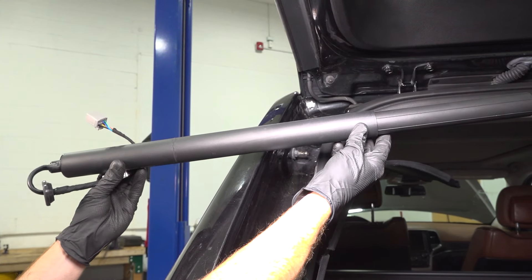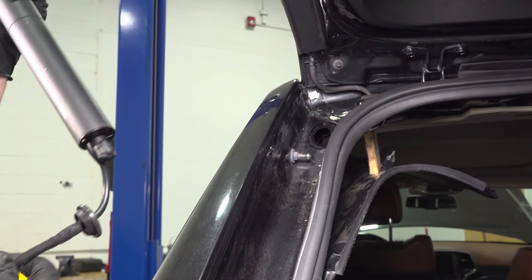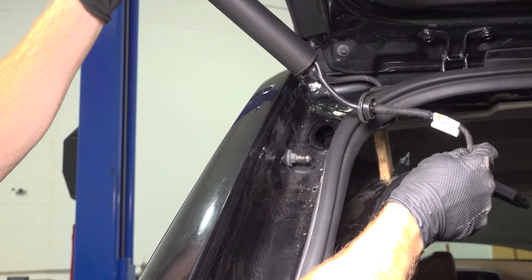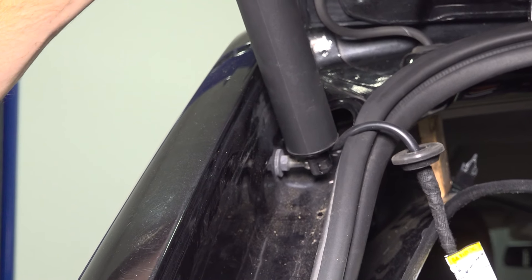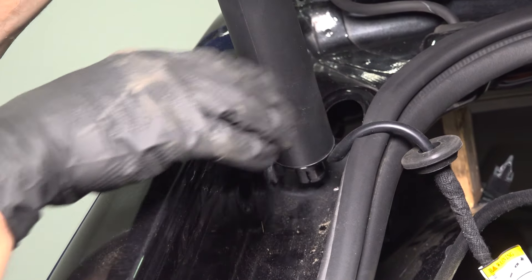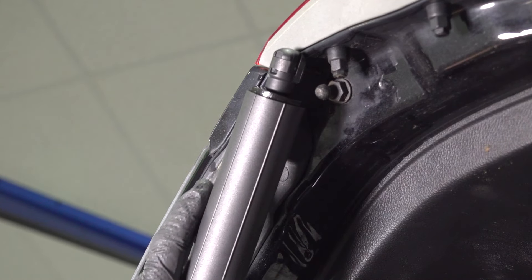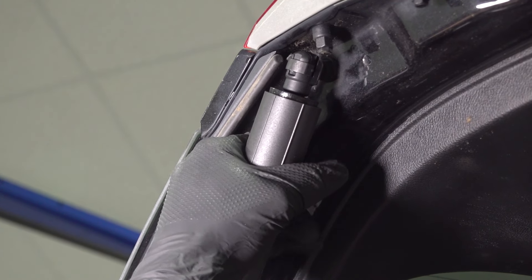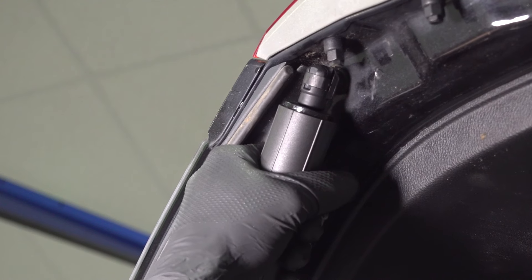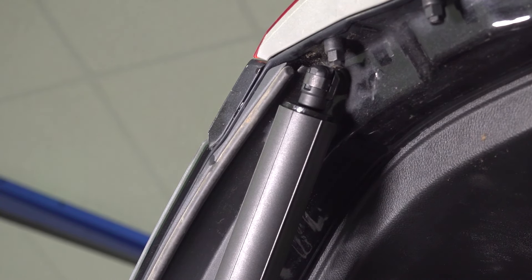Now it's time for installation of our brand new liftgate actuator. Let's start with the area that goes to the body of the vehicle. We're going to have our wiring harness — we want to make sure that's going to be able to slide right on through there. We'll line this up with its mounting point and press it right in. Listen for a click. Once you've completed that, let's follow this all the way up to the liftgate. You may have to raise or lower the liftgate as necessary. We'll slide this right into position — listen for a click, give it a tug, and make sure it's properly secured. Now we're going to make our way back down to the body of the vehicle and start our wiring harness through into the passenger compartment.